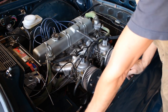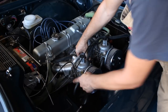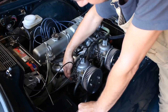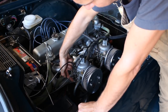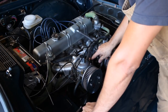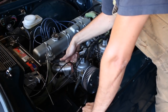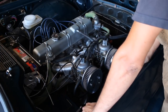Okay, so about the high RPMs, I think I figured it out. This shaft, the throttle shaft here, was not returning all the way. Even now it doesn't return all the way. So you see I added this spring here and a spring over there temporarily, so it returns. Because you see this little thing, there's just a little bit more that it can come, but even now it doesn't come all the way back with the spring, but when you let go faster, it comes back. So obviously these springs here are really loose, so I'm gonna have to deal with that later, but for now I just added those temporary springs here and that's fine.